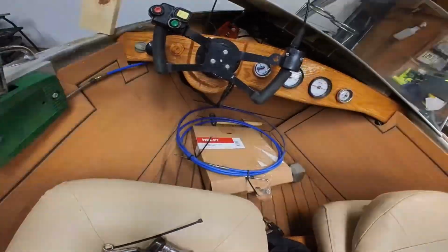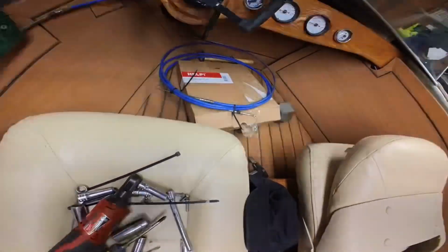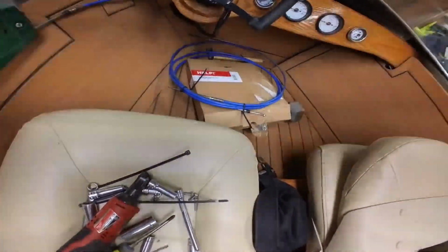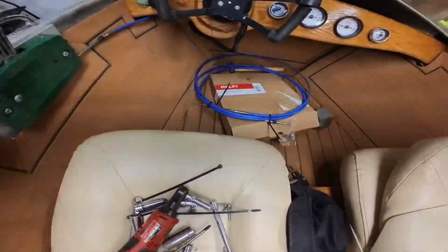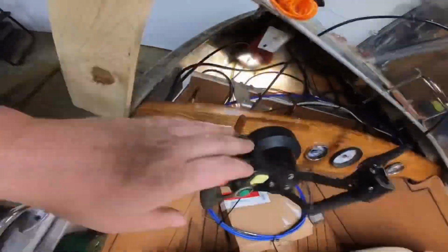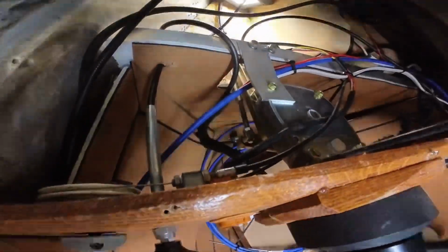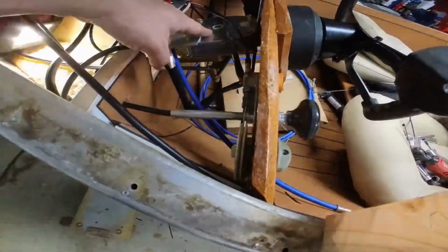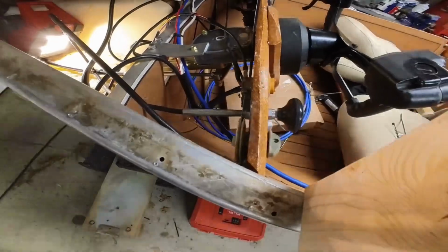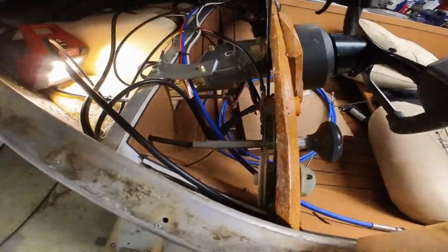People use them for steering cables, but it's 10/32. I think it's going to bend. I'd rather not be stuck on the river again with a bent steering cable. And I bent one, a 5/16 one. But that's because I overextended it. My old Helm was 315 degrees, so it pulled this inner cable too far out and it bound.